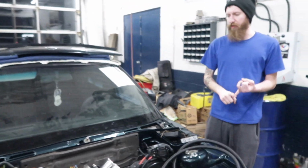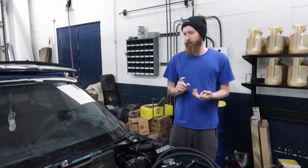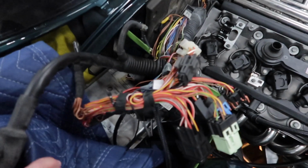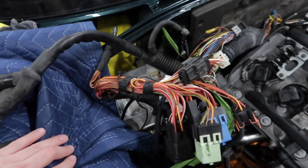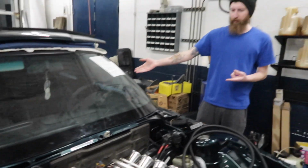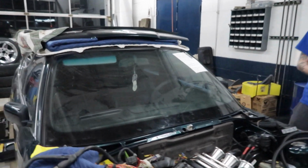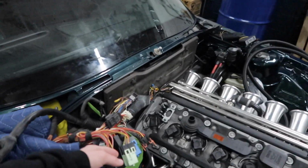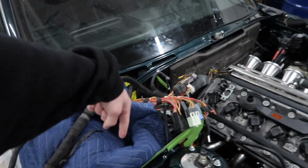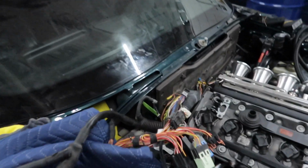It'll have a functioning OBD2 port. All my gauges work. That's really cool. It came with the fuel pump fuse, an adapter for the E34 style coolant temp sensor, so that it'll run my factory temperature gauge. That's cool. But otherwise, you use a stock E46 M3 engine harness? That is a stock E46 M3 engine harness. And the ECU goes where it's supposed to go? So I did find out I need like 3 inches of slack on the main harness.